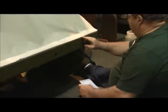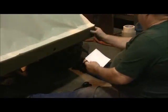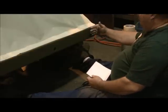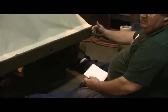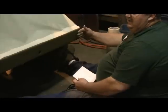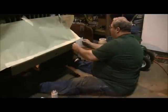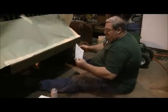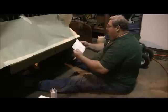The bumper is a little bit rounded, so there's a little bit of eye work that has to be done here. And check the end of your bumper. Different manufacturers, this bumper has a little bit of a curve in it. Some are more curved than others. And you've got to decide if you want to wrap it around there or stay off that curve on the flat spot. Either way, it'll work. It's plenty flexible to go around the curve if you wish.